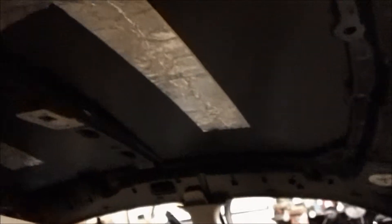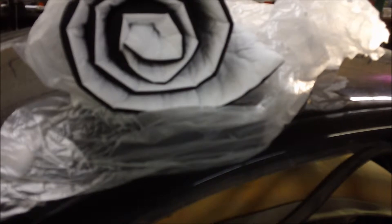I'm going to put some vibration damper up here. I just got this down for the first time and I wasn't expecting to find much — and that's when we get two little strips. So I'm going to fill in and put 3M Thinsulate Acoustic in there as well before I put the headliner back in. We'll take another look a little bit later on today.